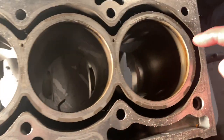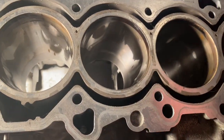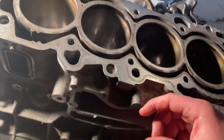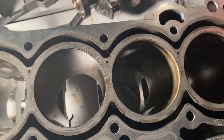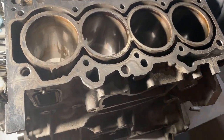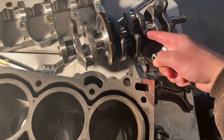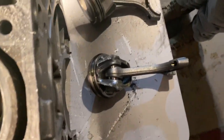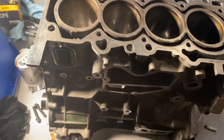On an open deck motor like this one you've got coolant jackets, which is better for cooling and thermal efficiency. On the ST, those are all filled in and the block itself is much thicker in some of the weaker spots. That's why if I rebuild my ST motor for power, I'd use that block — take it apart like this with crankshaft and pistons out, and build it with a bigger forged crankshaft and pistons that can actually handle some power.